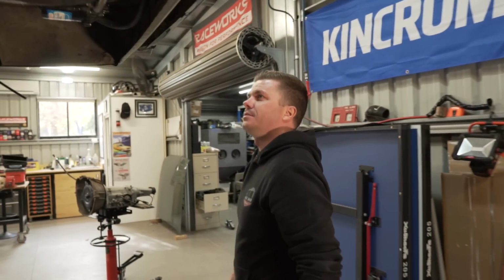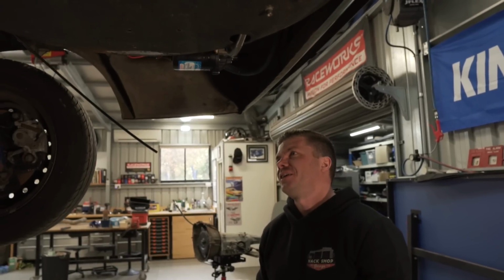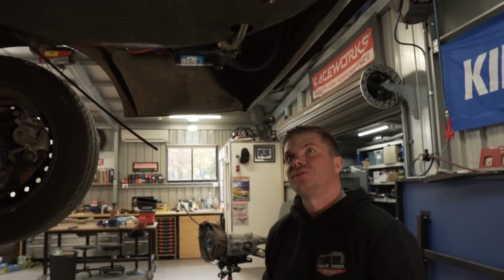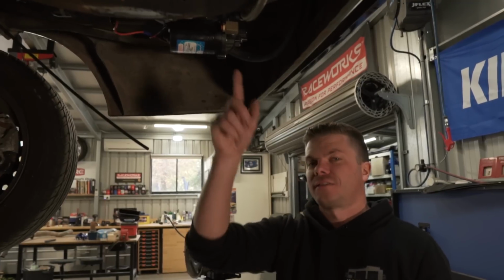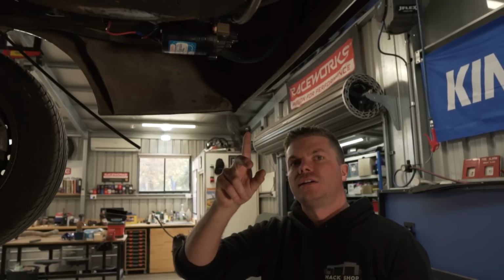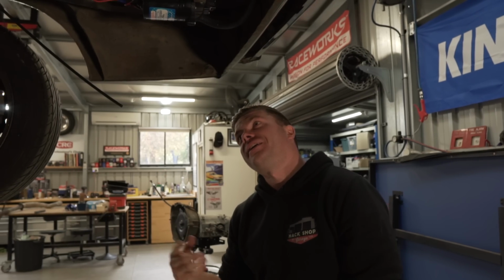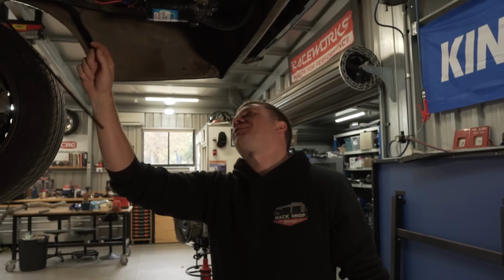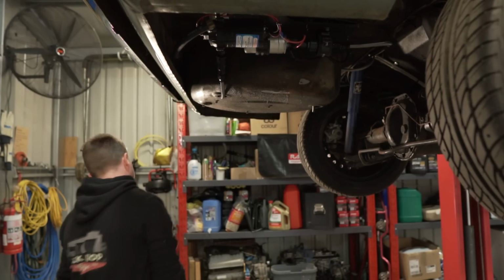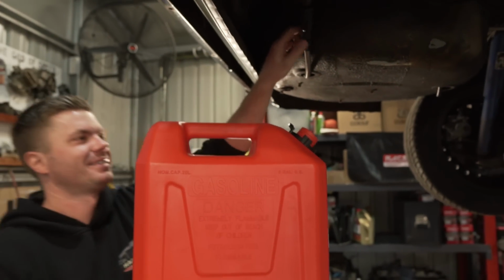All right, Michael, we're back after some pasta bake. What are we doing? All right, so next on the chopping block is the fuel system. So we're going to take the fuel system out now. What we might do is crack this line and put a jerry can beneath it because I'm pretty sure this is gravity fed. So it's probably going to drain everything. We'll let it drain out, empty the tank because we put 10 litres in the other day when we were trying to get it firing. Well, let's take this off. Why am I doing this? This is your job.